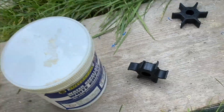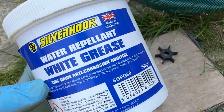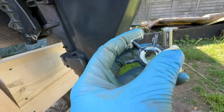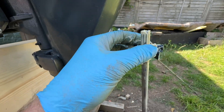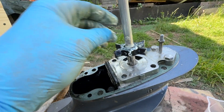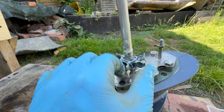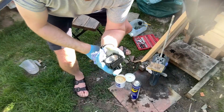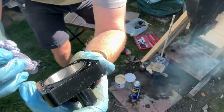New impellers! Right, time to grab your grease. This is white grease — standard industry-standard marine grease. We're going to put a tiny bit on the new impeller. You can see the key area is at 12 o'clock at the top — that needs to face down as you're putting it on. I've put a bit of grease on, and regarding the debate about greasing or not, I can see both sides. Greasing means it'll spin more freely. There we go — the pin has just seated nicely.